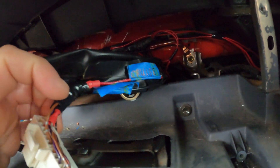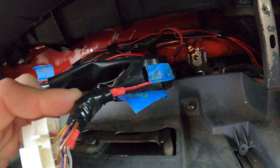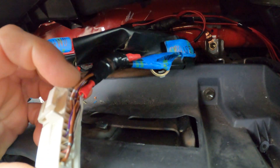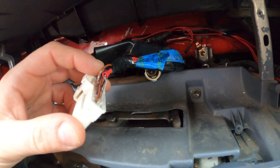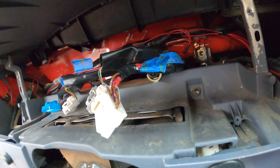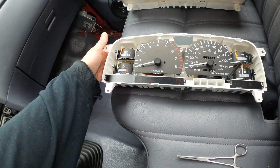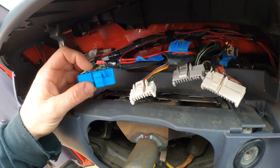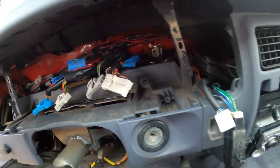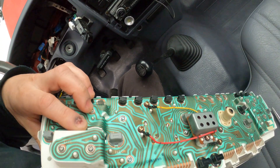The other wire I've run is the cruise control wire — pretty sure it's this brown one here, but either way you can figure it out on the back of the cluster. That just lets the cruise control light light up. Both the four wheel drive and cruise control wires are useful if you want to add indicator lights later for aftermarket accessories. If you don't have the salvaged clips to add wires to your stock harness and make it plug-and-play, you can do it manually — it's tedious, but you can run your tach wire straight to the back of the cluster.